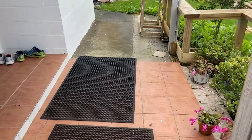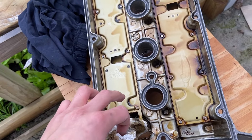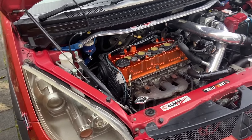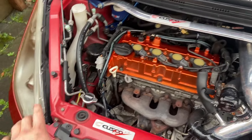That is how you do it — if you want to change the gasket and stuff, that's all you have to do. Looking at the cover I just swapped in, it looks way better: there's very little staining on the baffling — this is what it's meant to look like. The dark spots on the other rocker cover were from not enough frequent oil changes. All you have to do is take out the old gaskets, put on new ones, and that's how you do the gaskets. If you want to swap your rocker cover, that's how you do that too. That's it for the video — a simple rocker cover change and gasket transfer. Hopefully no leaks — see you in the next one.